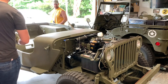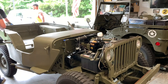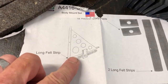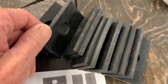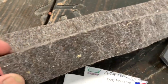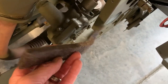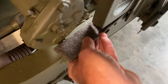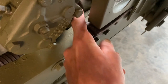It's not on the pad yet — that's okay, I can do it. No problem. Before we did all that, I installed the body mount set from Ron Fitzpatrick Jeep Parts. It comes with all the rubber body pads and then the two felt pads. I did install these with Permatex No. 2, and it seemed to work pretty well and kept them in place — I did that all before my neighbors and my son and my wife came out to help. Here's the felt pad — the felt pad slips underneath the front support or gusset there between that and the frame, as I'm showing you here on both sides of the tub.